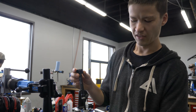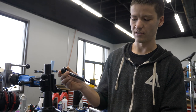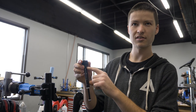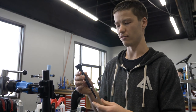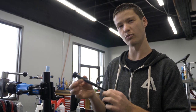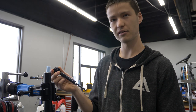Basically what this does is as that lower rod on the lower assembly comes up, once you get to the last 35% of the travel, it'll actually hit this bump stop. This is a pressurized air chamber, so this is gonna act like your volume tokens. If you increase the air pressure in here, it'll act like adding more volume tokens — it'll ramp up the further you go through the travel. So you can pressurize these anywhere from 5 to 50 psi. They come stock with 20, so we're just gonna leave it at that. And Doug can play with it and tune it in to what he really likes once he gets out on the trail.